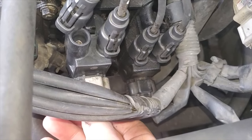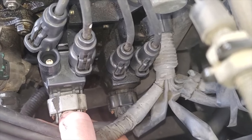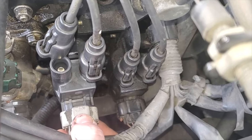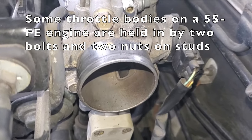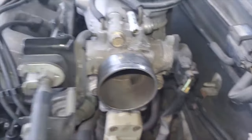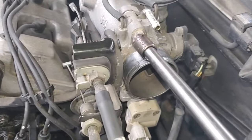And of course there's an electrical connector. You pretty much just push on the button down here — you can't see it because I got wires, but there's your button. Push down on the button. And then you do the same thing for the other electrical connector. There are three 12-millimeter bolts that hold the throttle body to the intake manifold. There's one right here, one down here, and there's one in the back right there. I've already busted these suckers loose on camera, so I'm going to try to get them off the rest of the way now.